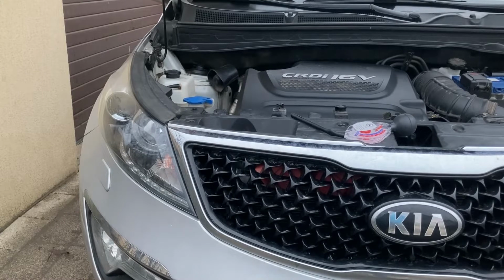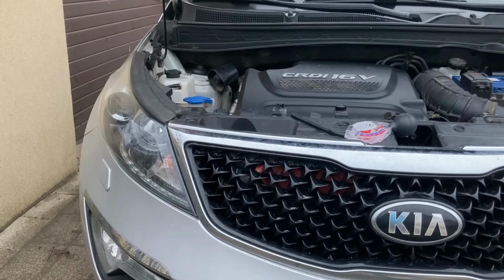So first, let's see what we're expecting. Since we got about 3.2 liters of pure antifreeze to the 8.5 liters of the entire system, that works out to 37% concentration of antifreeze based on the freezing temperature charts that I read. This should correspond roughly to somewhere around minus 20 degrees Celsius freezing temperature of the mix. And let's see what our densimeter tells us. Let's see if we're right or we're horribly wrong.